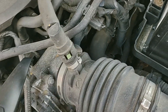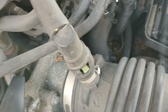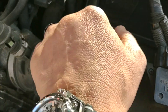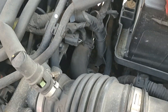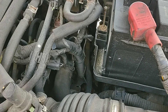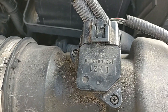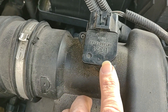Make sure you check this hose thoroughly - check it at the bottom, see if there is any leak. Check all hoses between the throttle body and the air intake. It's very important to make sure no air is entering the engine from here. Sometimes there's a vacuum leak somewhere else, but I'm not getting any vacuum leak on this car. The reason I made this video is because I really did clean that sensor a year ago and it worked.